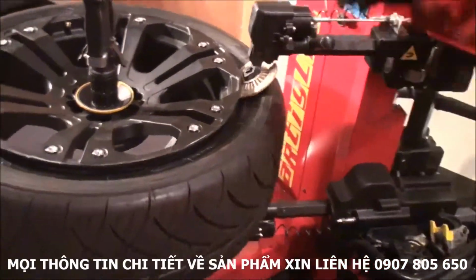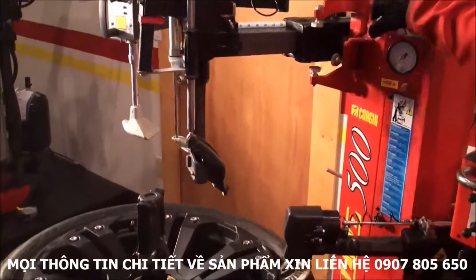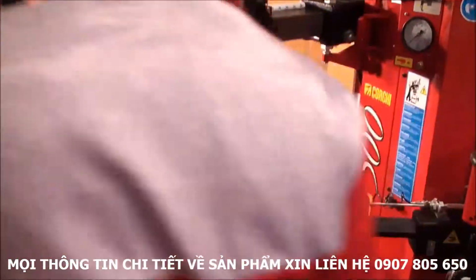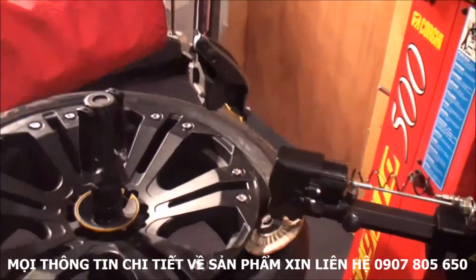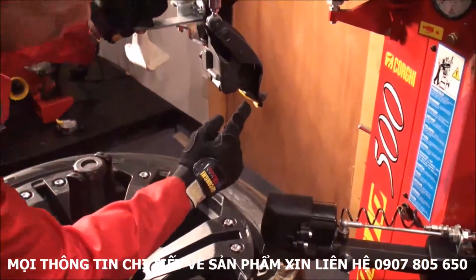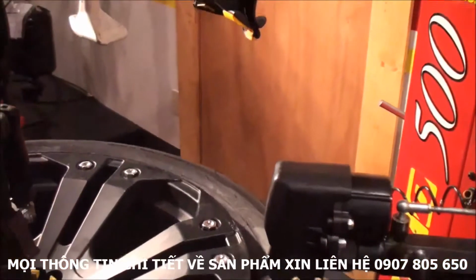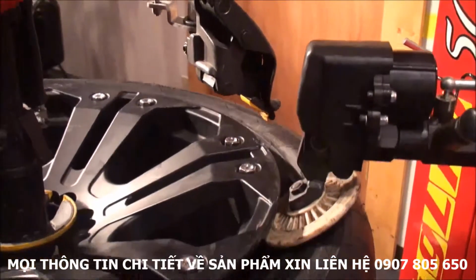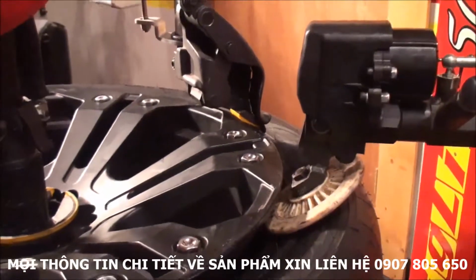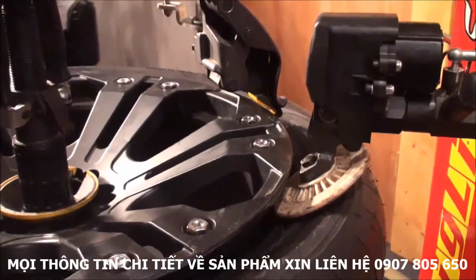Before breaking the bottom bead, I'm already going to put the head on top of the rim. So again, just release it. It's now free. Go down, and I make sure this corner goes right on the edge of the rim. So just come down against it, and when I lock it, as you can see, it goes out and up.